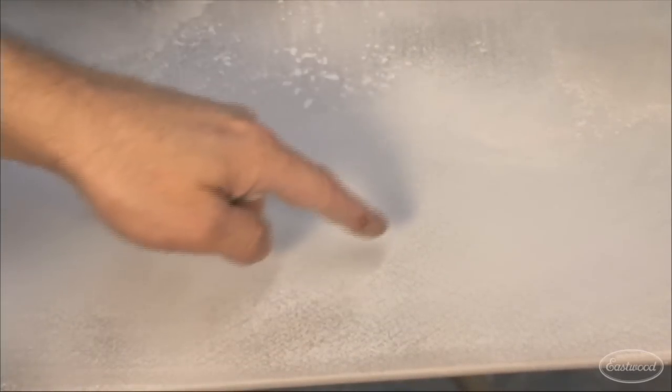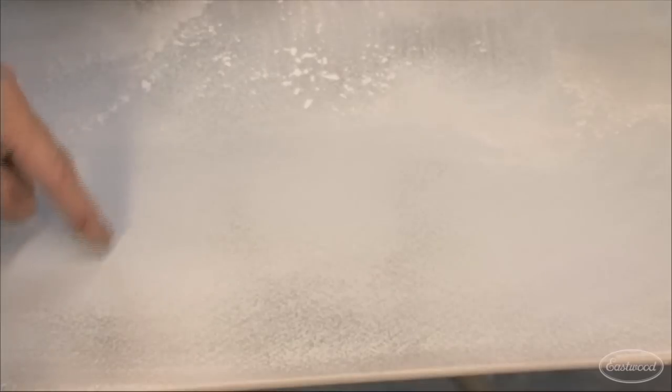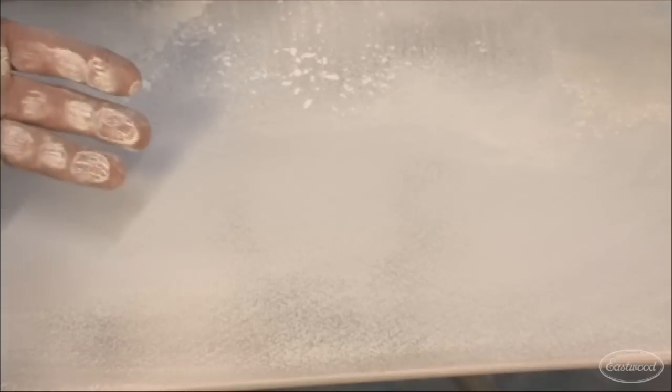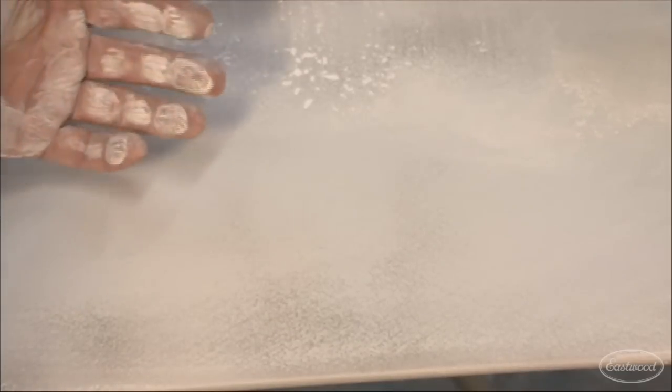Now, really quickly, it becomes very apparent exactly why a guide coat is important. You see all these scratches, and the bald spots here, those are high spots. The dark spots are low spots. This is going to tell you how flat your surface is. So the guide coat, in conjunction with the high build poly, well, it guarantees that you can straighten out a panel and you won't see those crazy waves in the clear coat when you're all done.